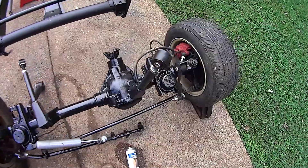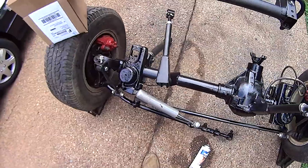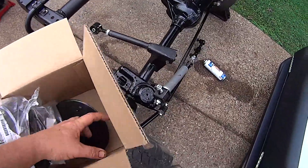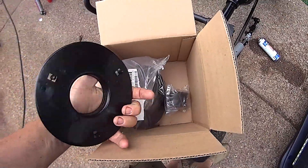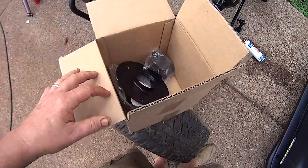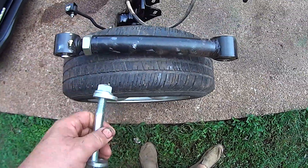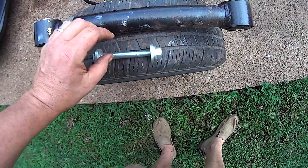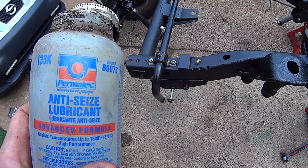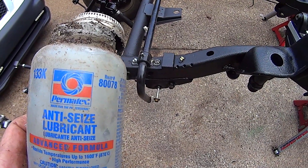Last night I painted it — I didn't film that because one less video about painting something is okay — but it turned out great on the front end. I got in my cushions for the rear springs, little plastic cushions, and my bushings for the rear stabilizer that I've cleaned and got all the rust off of. We've got our special cam bolt and the control arm set to the right length, about 15 and a half inches. Use anti-seize on all the front end parts so when you're doing alignment it'll come right off. We're going to go ahead and install that.